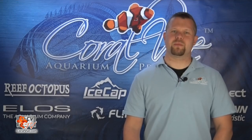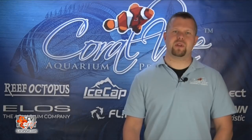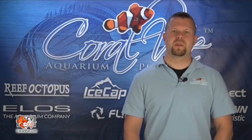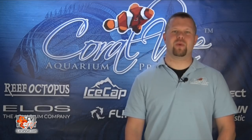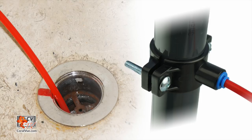To connect the water supply, attach the white feed line to the cold water supply using the included garden hose feed adapter. If your faucet or utility sink does not have garden hose thread, you can purchase a feed water adapter or faucet coupler from your local hardware store. Next, connect the red wastewater line to the supplied drain saddle or place it in the drain. This line will produce a good amount of pressure and should be secured and directed into the drain at all times.